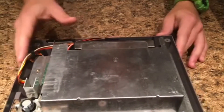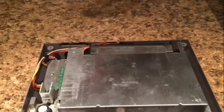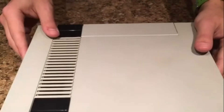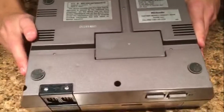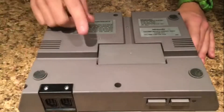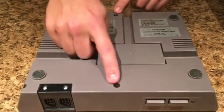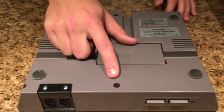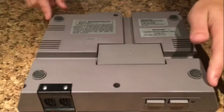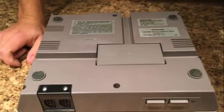My RF shielding is all screwed back into place and as you can see it still works fine. Now it's time to put the lid back on — this is really easy because it's just a perfect rectangle. Drop it back into place; it may take a bit of finagling to get perfectly lined up. Make sure you don't have any wires caught anywhere. Turn it upside down and put in your six screws. Again, test after every single screw to make sure the cartridge thing clicks down. Do this front middle screw last — I would say do all four corners and the back one first, then that front middle one last, because 90% of the time that's the reason the clicky mechanism doesn't work. It has to be pretty loose to get it to work.